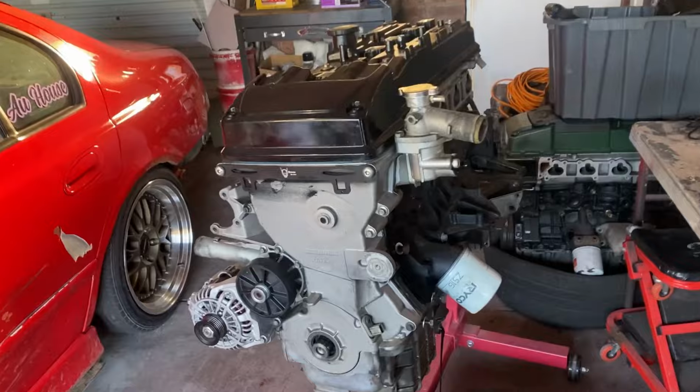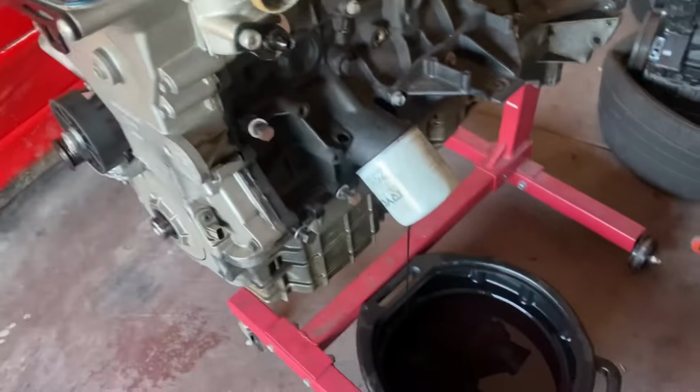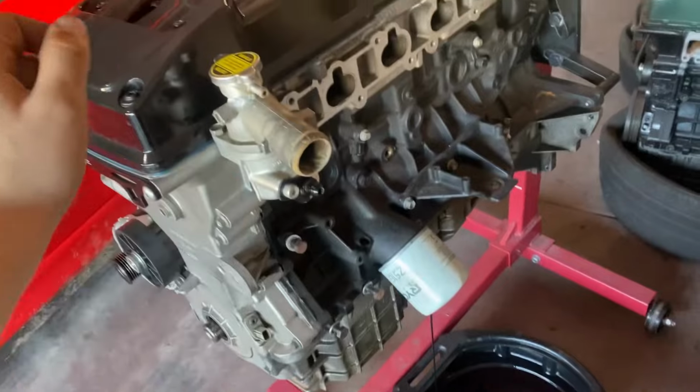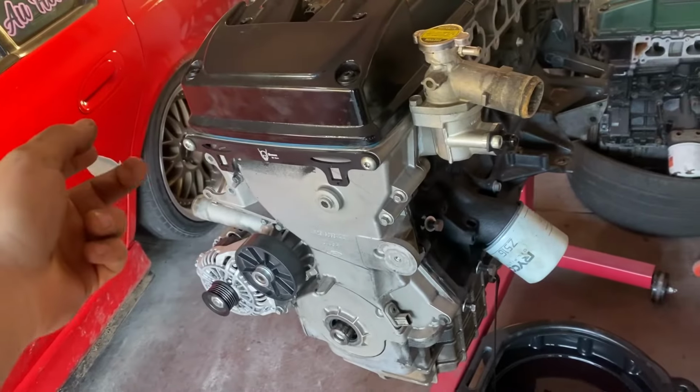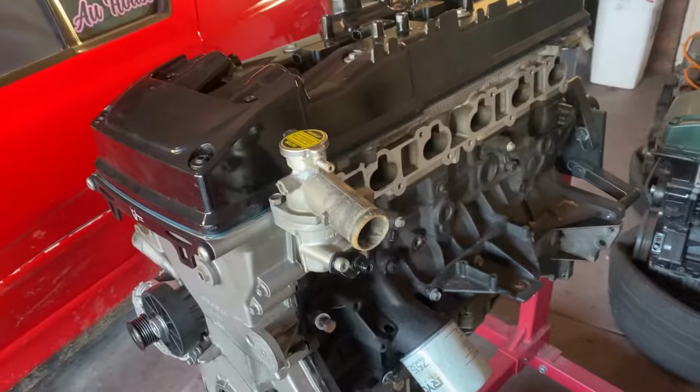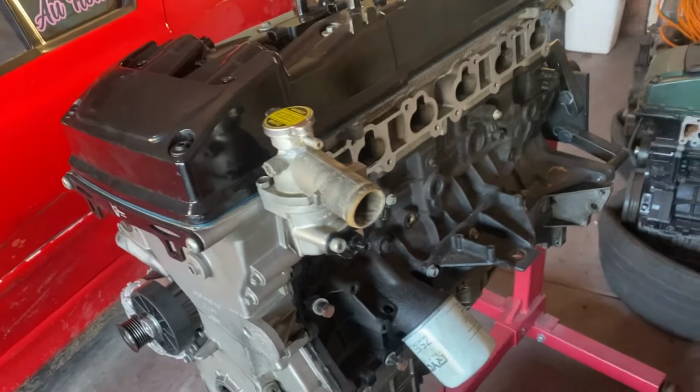Welcome back to another day. I've got to start filming, but I've been ripping the motor apart. It's taking stuff off slowly. Just took the manifolds off it. Drained the oil, about to rip the timing cover off, sump and the rocker cover. Because obviously I'm keeping this head on the new motor because it's got the valve springs and stuff. And obviously putting a head gasket.